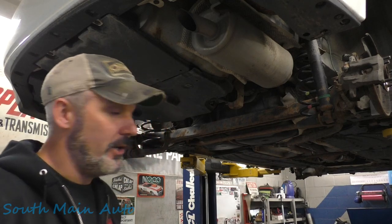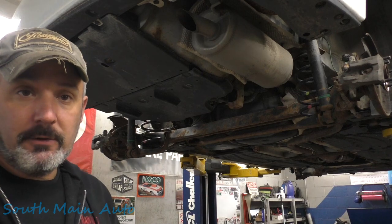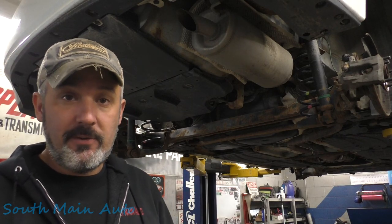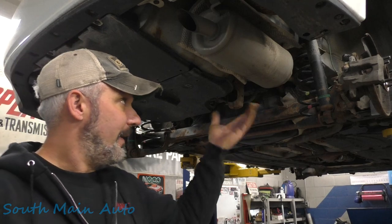But definitely understand some of the logic and the algorithm behind some of them if you're having a hard time. These work on an extremely low amount of current, 20 or 30 milliamps of variation that they see. So when you're using your scope, you've got to AC couple it and really zoom in on the waveform to see it. So that's that. Needs a bearing.